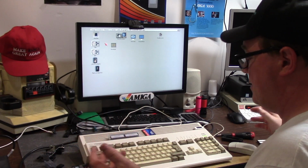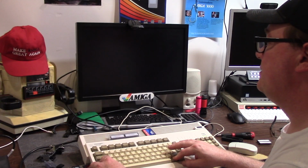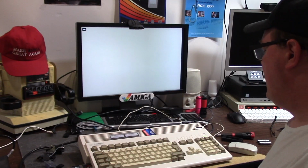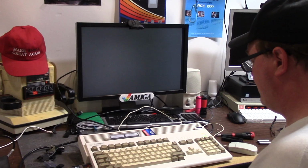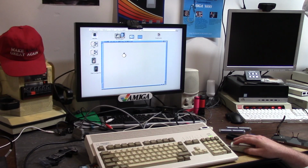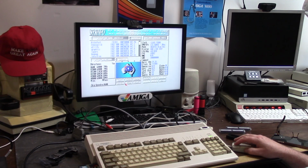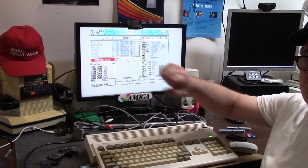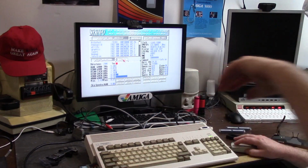That sucks. Now on this card I can hold Control-Amiga for 3 seconds and let go, and it will reboot into a 4 megabyte mode, and I'll have my PCMCIA available. All right, so we're at 4 megs, we have 2.7 left. Here's my 512 meg compact flash, and it all works fine. SysInfo from it, 4.0. Of course, everybody has to click speed, and then if you've got a tiny one, click the expand. It's kind of like giving it a tug. 47.96 Kickstart, expand.